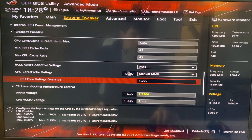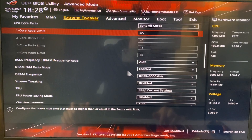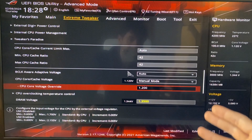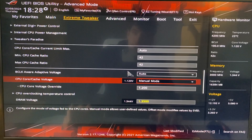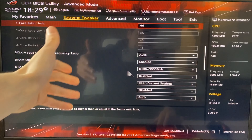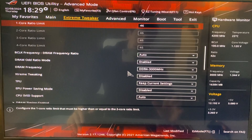Once you've reached your stability or temperature target — say 1.2 volts — you can then try increasing the cache or core ratio a little for some voltage-point overclocking, which results in more performance. For example, if your CPU was overheating at stock but is fine at 1.2 volts, maybe you can push it to 4.6 GHz — free performance. This is basically how you undervolt your 6th, 7th, 8th, and even 9th gen CPU. If this was helpful, please drop a like and subscribe!